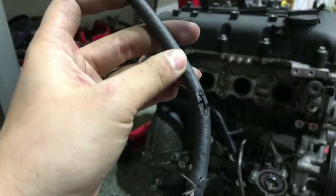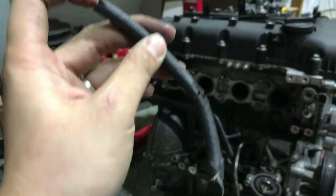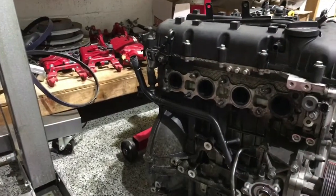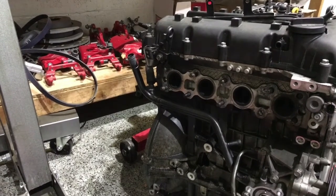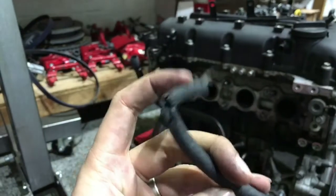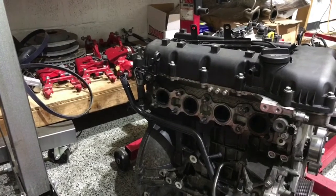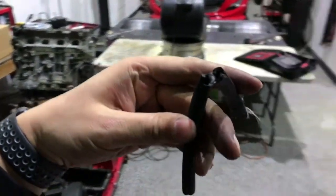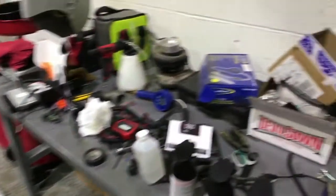This is a line that used to go to the wastegate from the boost controller solenoid — the OEM boost solenoid. Basically what it does is read the boost coming off your turbo, decipher how many PSI it's running, and when it gets to a target boost level it sends a signal to the wastegate through this vacuum line, which pulls the wastegate open and keeps boost where it should be. But with this line broken, you're going to see full boost and your wastegate will remain closed the whole time, even though your boost controller is doing everything in its power to open it.